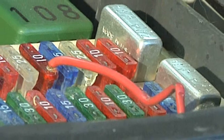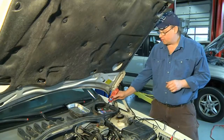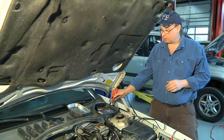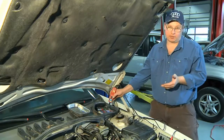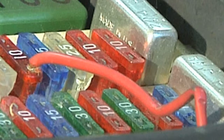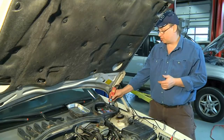But if you need to have a 12-volt auxiliary ignition circuit, for whatever reason, you're going to find the fuse that you want to power up. You'll check your fuses and find one with no power. You'll check your schematic to be sure you're not taking from something that's very important, like engine running fuses. And then you'll adapt a 12-volt circuit to that fuse on the back side of the fuse so that it's protected. You can even add a second fuse after the circuit.